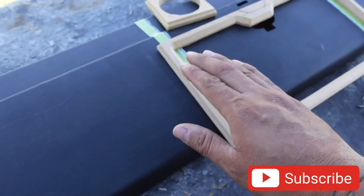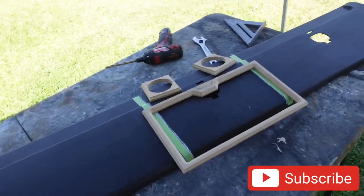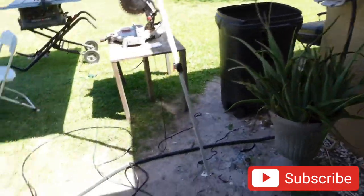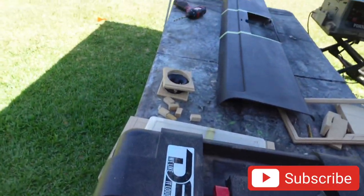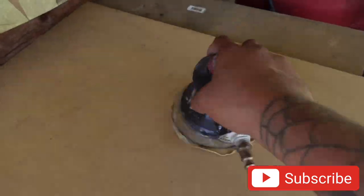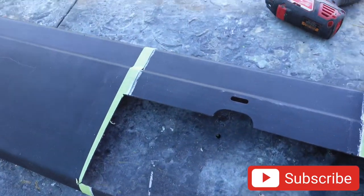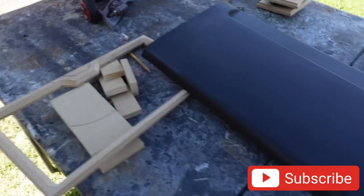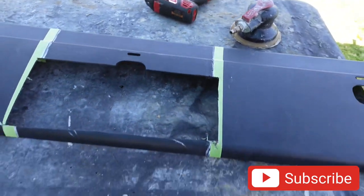It's going to look really badass. This time I'm going to bring the fleece out a little bit more so I can blend it out a lot nicer than the last one — we step up our game on these every time we do them. We have to DA her down so when you put the hot glue on her it grabs it really nice. The DA is right in front of my face. We already cleaned it with the prep, so now we're going to take this tape off and line it up — center this guy out as best as possible, make sure the tweeters are nice and even on both sides, symmetrical, then glue her down and the skeleton is done.